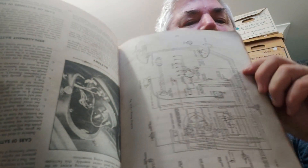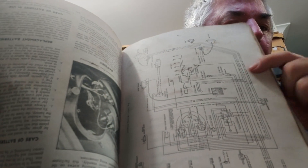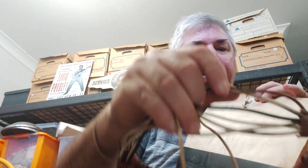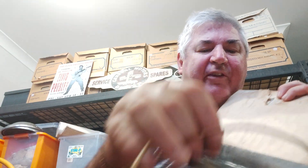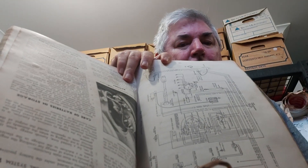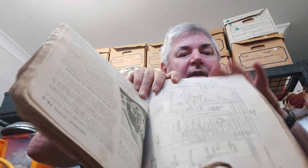I continue to tell subscribers about the worth of the shop manual. In the shop manual itself, on page 236, is the wiring diagram. This will tell you what all of these wires are for and where they go — for instance, this one natural with black tracer, this one natural with red tracer, brown, green, red, and you name it, it's all there. This is what you need to decode all of that. It is the secret to all of it. Use the wiring diagram.